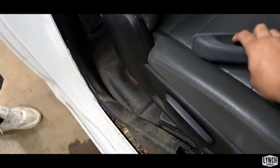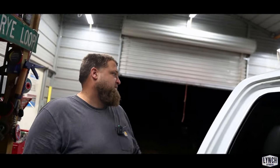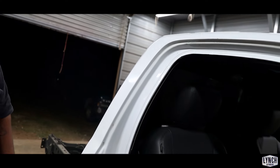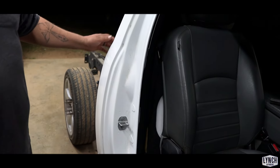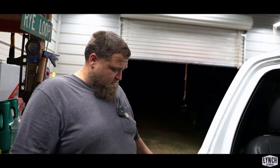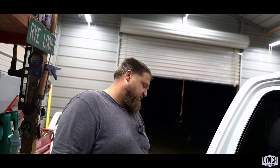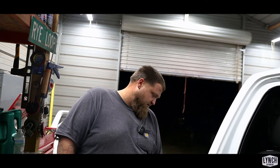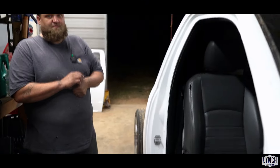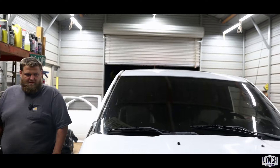Got to sand those and prime them — these are going to be white too. Just get the back glass out, the front windshield out, and get these latches off and all the little stuff. Do a real good clean on it, you don't want any grease residue. Then really go through and find every little imperfection, prime it, and then block it to make sure I get all the dents. White is hard because it doesn't really show every imperfection like black would. Everybody I talked to said black is probably the worst color to paint — it shows everything.